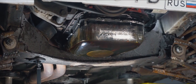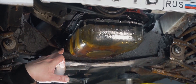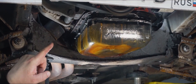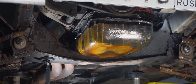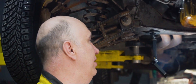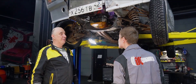The oil is coming down from all over the place. It's not only by a dedicated channel that it drains, but also from around the crankshaft and the piston rods. You can see everything very clearly. Maybe we should pour in a bit more. Switch her off, Ivan. I guess we pour it in through the dipstick hole — we don't have enough oil. It's coming from the rods. It's coming from the mains, the crank and all that. It's foaming because there's too little of it.